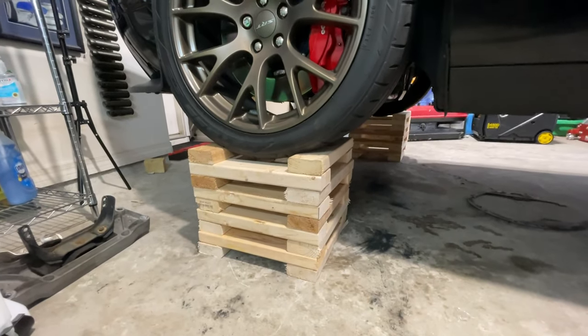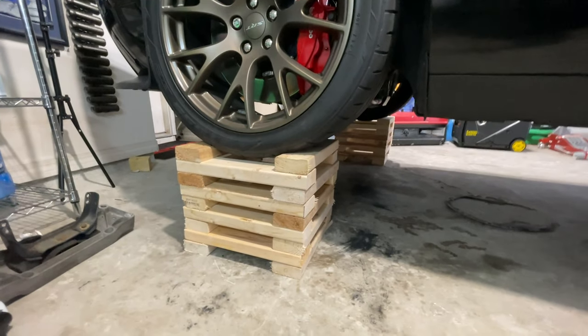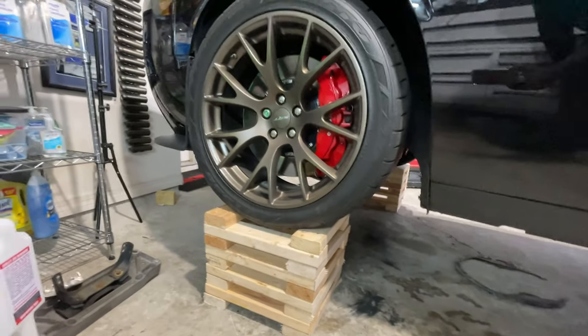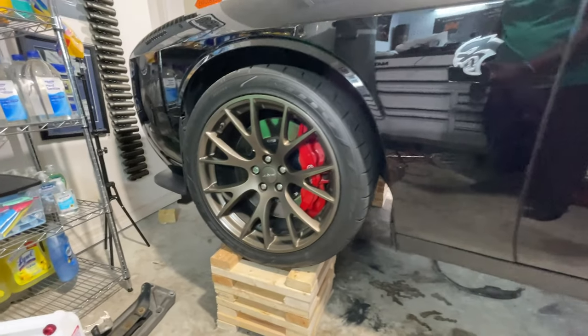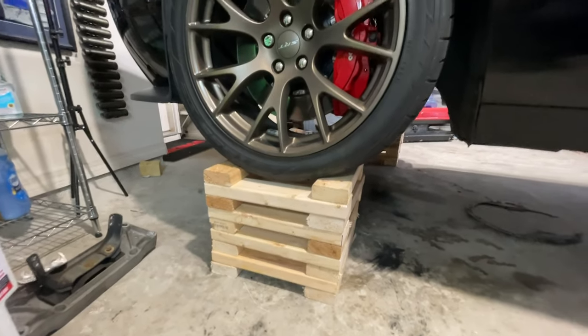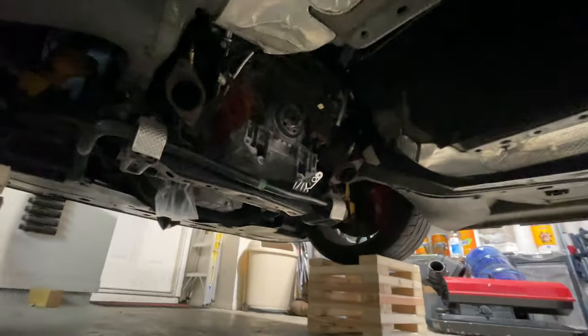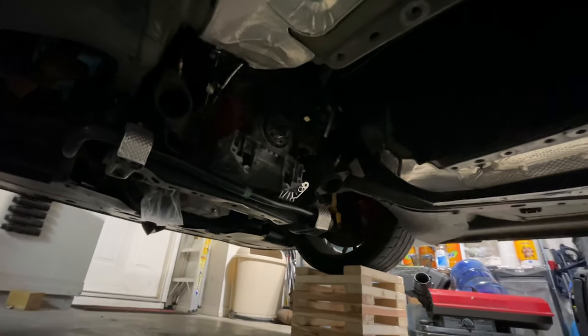Right there, we had it higher, we had it 16 inches, but we couldn't get the car any higher with the size jack that I had. I needed probably a long reach jack to get it up higher. So with the jack I had, that's as high as we got it, which is high enough to where we could slide the transmission underneath to get the bell housing underneath, because the bell housing is the biggest part. So as you guys can see, no transmission is in there.